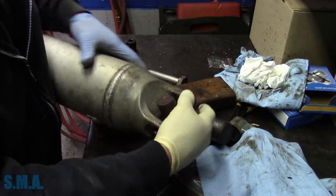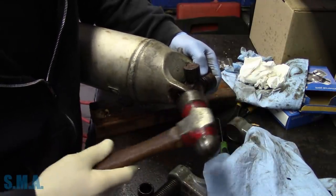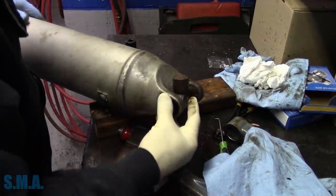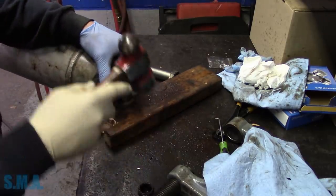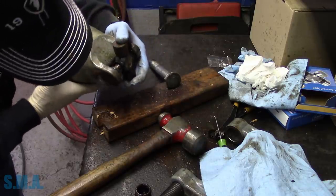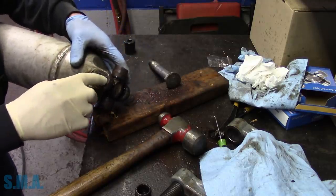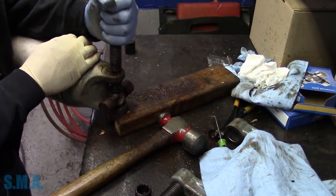Let's see. If that'll come out, that'll be fantastic. But I think that might have been the result of the crappy cap on the other one. I'm thinking, son of a monkey. Well, what if we drive this cap up to its breaking point and then try to pop the cross out of it? Do we have enough room now? No, we don't. Son of a hoosky. That sucker is super corroded. What would Meemaw do? We're gonna have to drive it out, try to square this up a little. Square it up, round it off. However you want to say it. Because we're gonna end up driving it through.